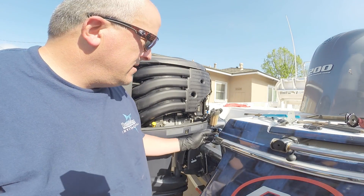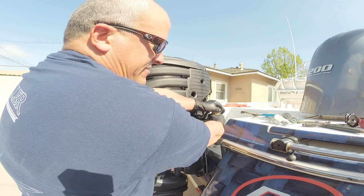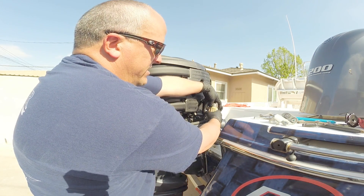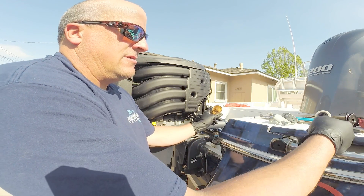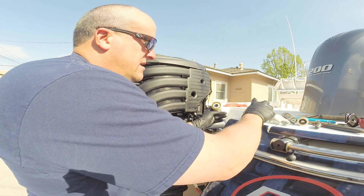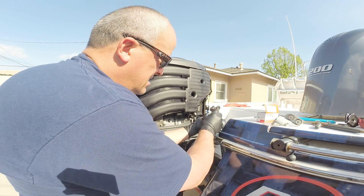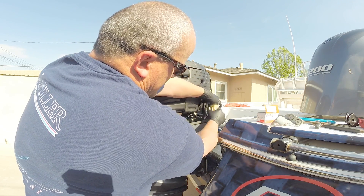The final step is replacing the fuel filter. This is the assembly — it's attached to the motor. It can be tough to get off, so you have to grab it and twist it free. Mine was really stuck, so I used channel locks to get a better grip — but be really careful because it's made of plastic. Once you unscrew it there will be fuel in there. I already dumped the fuel out into a can, and now I use the tool to take the old filter out, get the new filter, and put it in the same way the old one came out. You can see these two filters look pretty different — the old one has a lot of buildup you wouldn't want going into your motor. So it's good to change this every hundred hours. Put it back in, mount it up, and screw it back on hand tight.